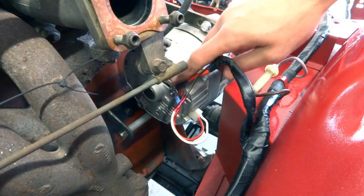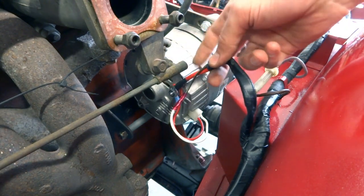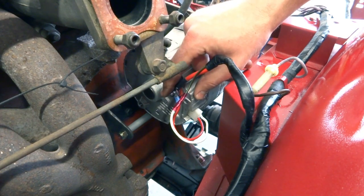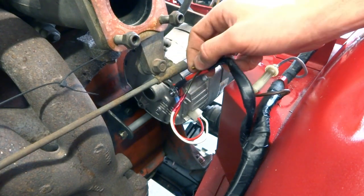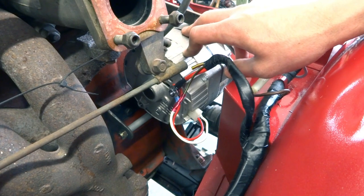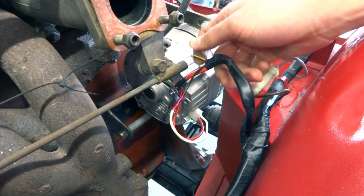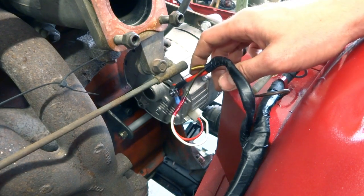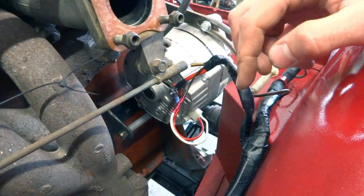On the alternator side, what you're going to find are three wire connections. Now, one connection is the main charging power cable. And let's talk about that one for a second. So the original Triumph wiring was set up for the generator, which could provide about 20 amps. This new one's capable of putting out about 60 amps. So running that through the original wire does pose a few issues, so what we've done to alleviate that is basically abandon the original wire and run a new 8-gauge cable through the harness and back to the next point in line, which I'll show you in a second.